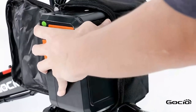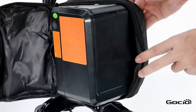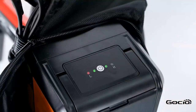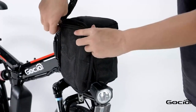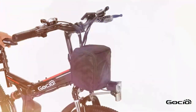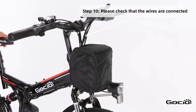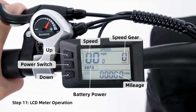To turn the bike on, push the button on top of the battery. The lights will light up on top. Double check all the wires and make sure they are properly connected, and that the bike can turn left and right without any resistance. Turn the secondary power on by holding the middle button on the control panel.